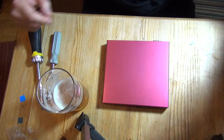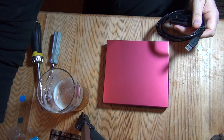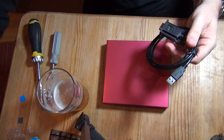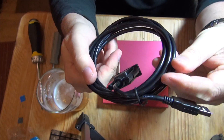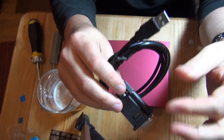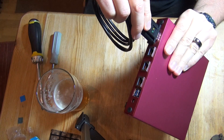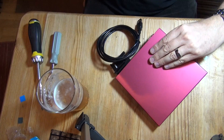Let's talk quickly about some downsides. First of all, no VGA out — you're going to have to use a serial or null modem cable. I bought one; I would recommend this StarTech USB to null modem. Null modem cables themselves are not expensive, but you do need the right kind of serial port on your PC to talk to it, and you will need this as part of the installation. If you don't care about power usage, a cheap or old PC would probably do as good a job, just eat a lot of electricity. If you want a practice or trial, do that.